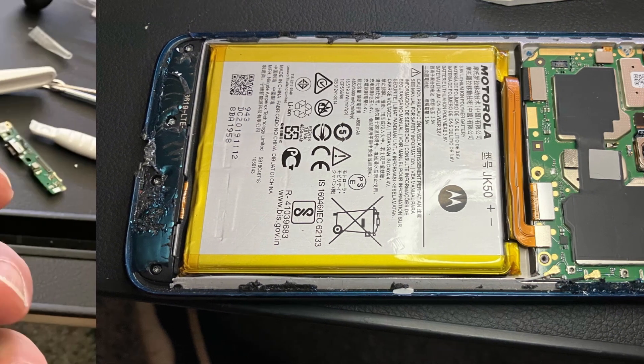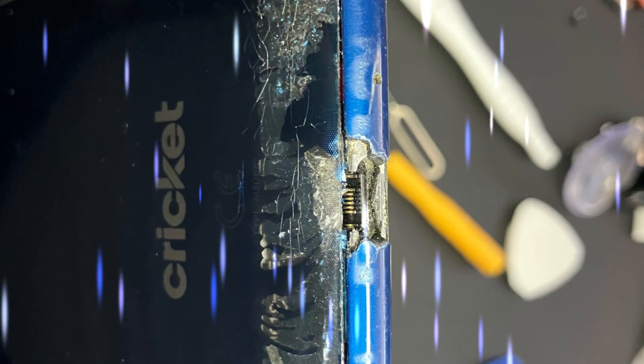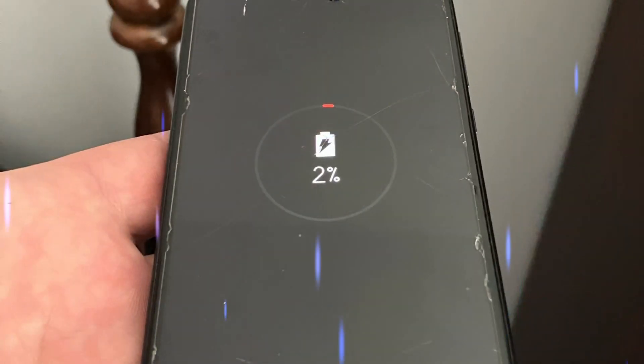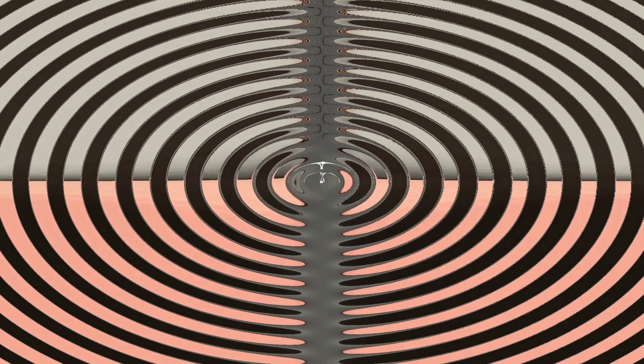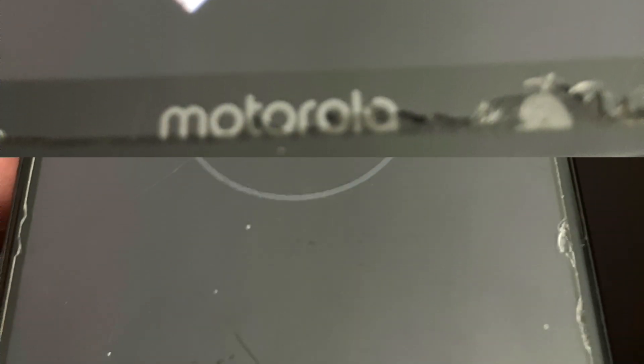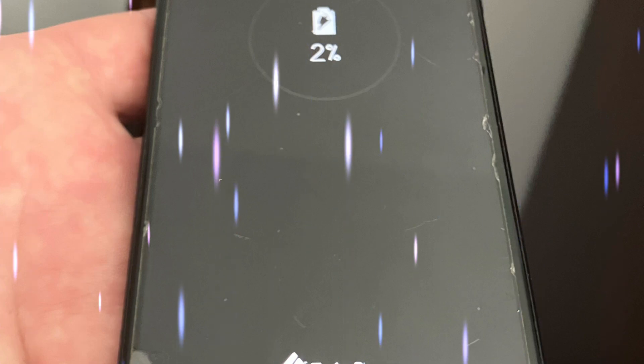Making progress. You can do this, and these phones you can find for like 20 bucks on eBay with this broken part — you can put them back together and it'll absolutely work. Links for this project will be in the description. Make sure you match up those model numbers, because they'll be a little different based on whether you have the Power, the Turbo, Super, whatever. Look — the turbo power is on, it's running, it's charging. This phone hasn't been able to charge right in years and hasn't turbocharged in forever.